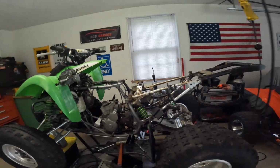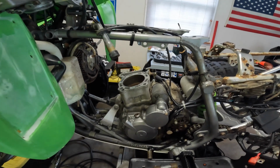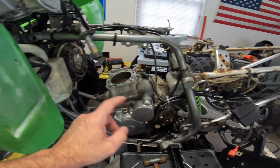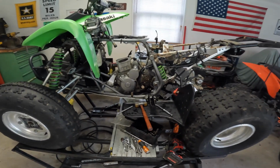So with that being said, it's kind of late in the day now. I'm gonna call it here, and where we're at is we have the head off. I'm not gonna pull the cylinder. I'm gonna do that on the bench. So about the only thing we have to do now is just disconnect the wires, the front engine mount, swing arm bolt, oil lines, and pull this thing out. And we'll do that in the next video.